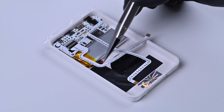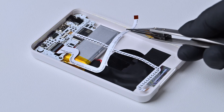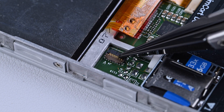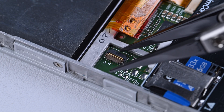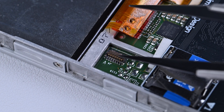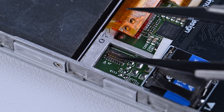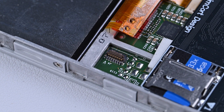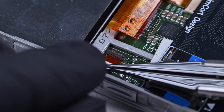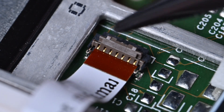Now we've finished preparing Classic Connect. Step 4: Install the cables. Insert the audio cable into this latch. Watch how I open it — not from the black side, but from the grey-brown side. This latch is quite fragile, so open it gently. Push the cable in carefully until it's fully inserted.